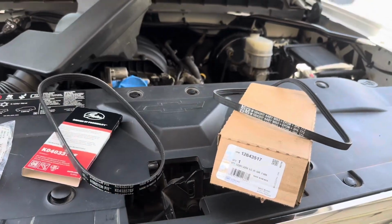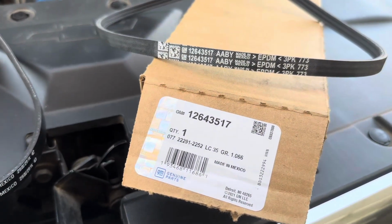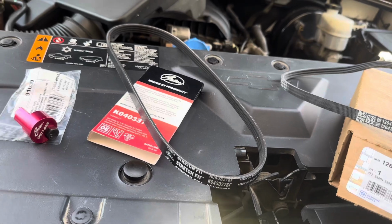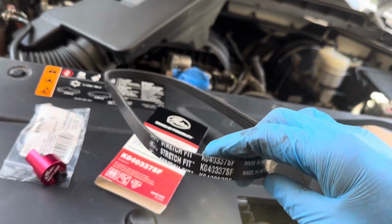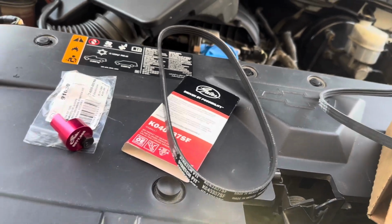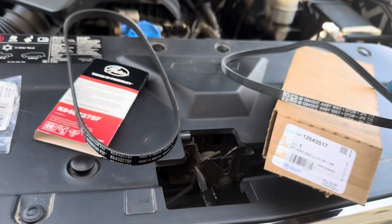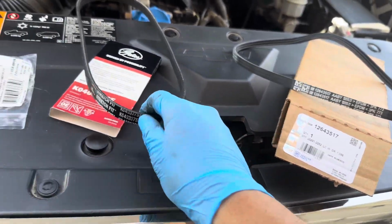So this belt here is for the brake vacuum. There's a part number. I'm gonna have them in the description as well. And then this one is for the AC compressor. It's a Gates one. I couldn't find an AC Delco one nearby. And then this Gates tool is gonna be what we're gonna use to put on the brake vacuum one. With the AC one, you just need a zip tie.